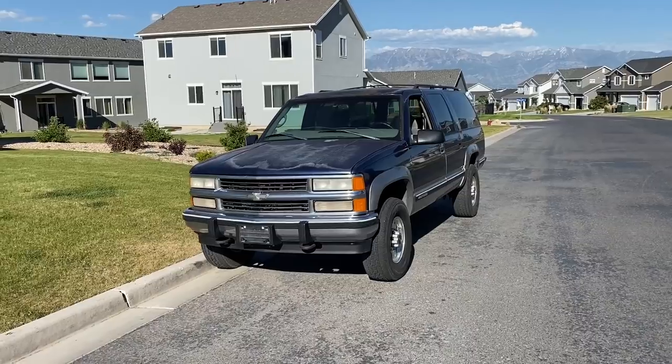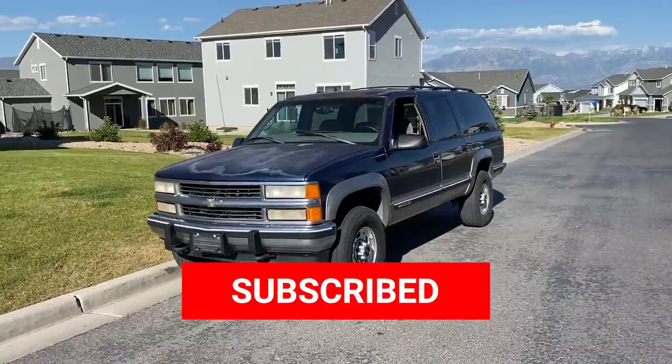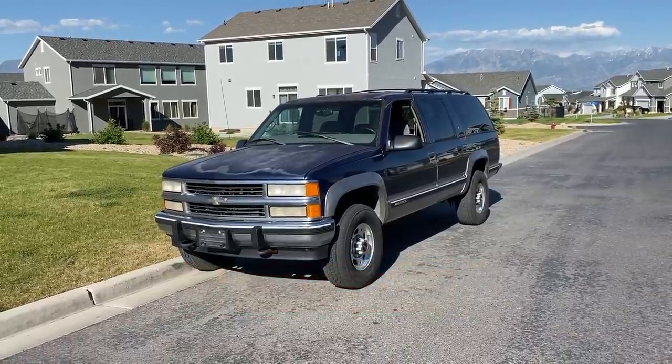Today we're going to be spending some more quality time with what is quickly becoming my favorite project truck that I own, the GMT 400 Big Block Suburban. Now last time we just finished up the different axle swap on the rear. We converted to a Dana 70 mainly because it's wider, but also because we got disc brakes along the way and a limited slip, both things that the 14 bolt full floater did not have.